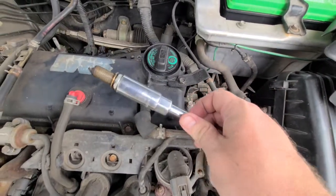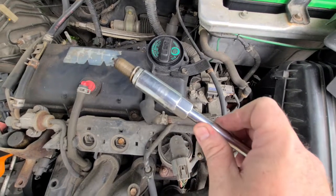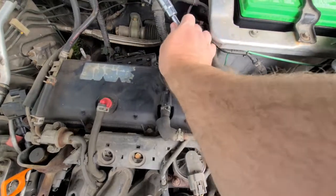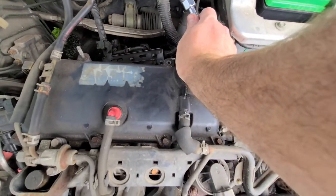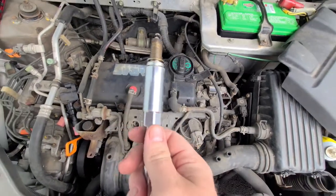So that's what mine is looking like. Actually it's not too bad, although there is some oil there — so if I had to guess, I'd say the spark plug grommet might need to be replaced soon. That isn't that bad of a job and I'll get to it later, but go ahead and take all three out and we'll put the new ones in.